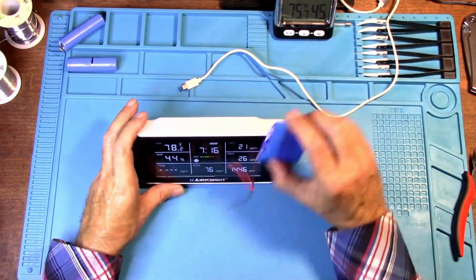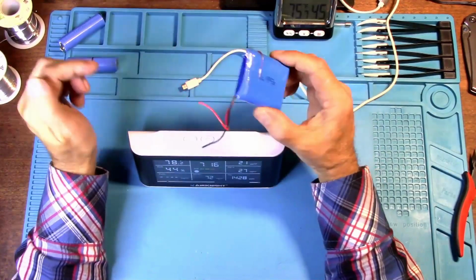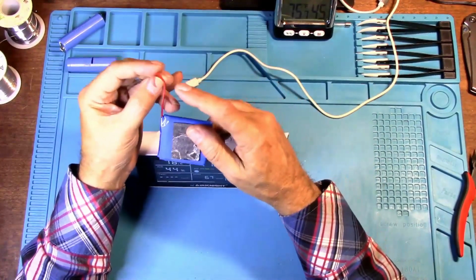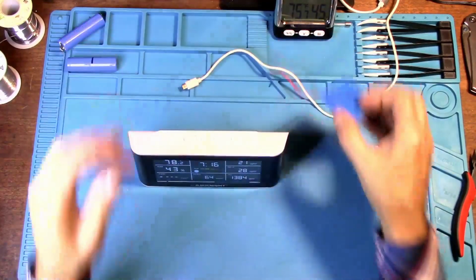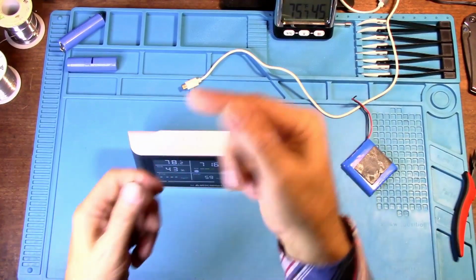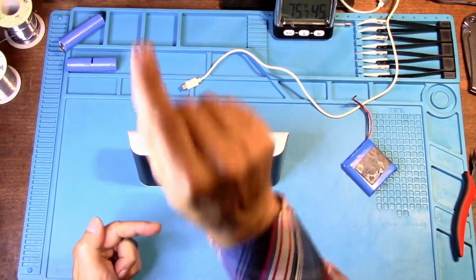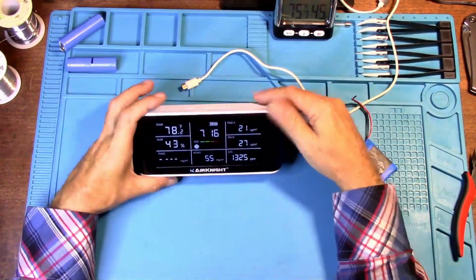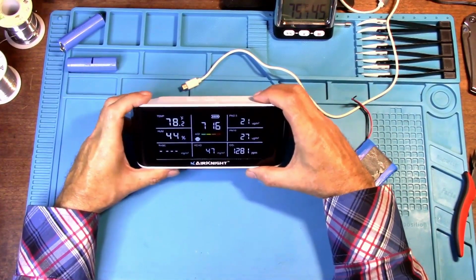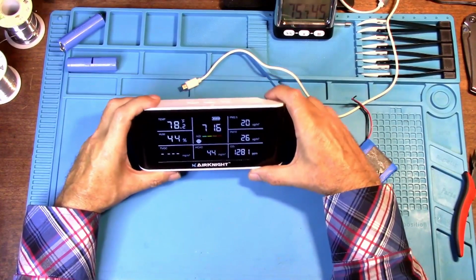Definitely 100% acceptable. But if you feel more comfortable, then by all means, use the Schottky diodes on the red wire. But make sure you use 2 diodes, one going one direction and the other one going back, so voltage can run forwards and back from the battery. It's up to you what to do. I was just showing you how to do the replacement.